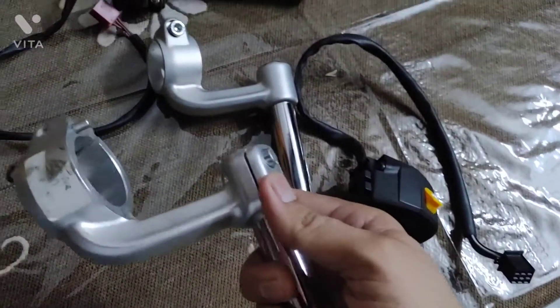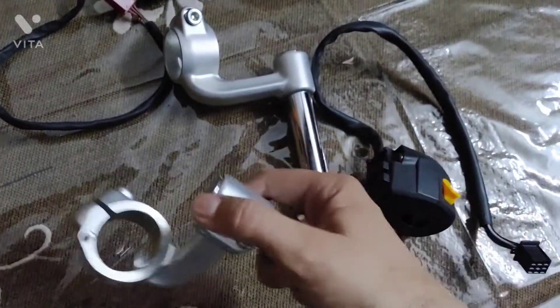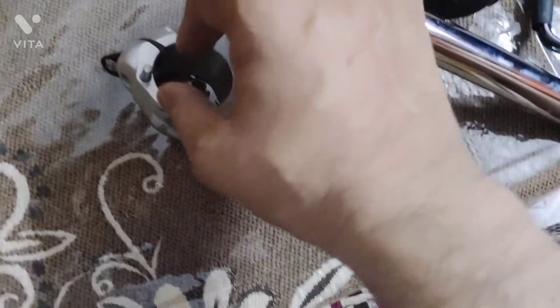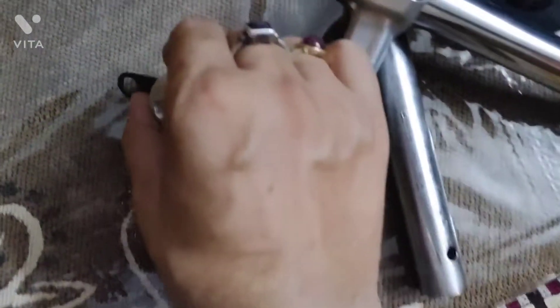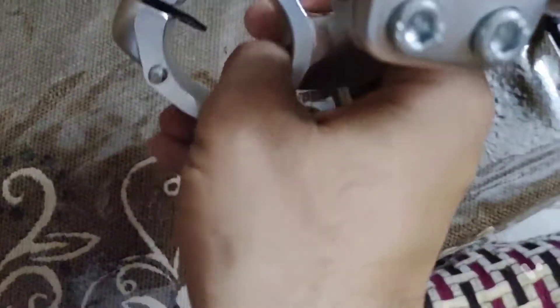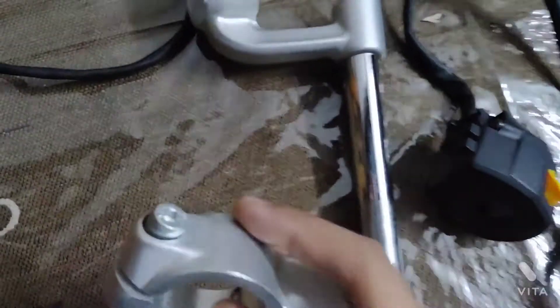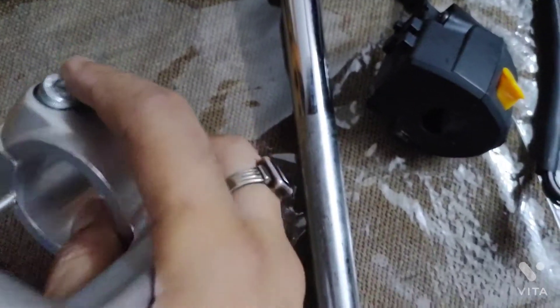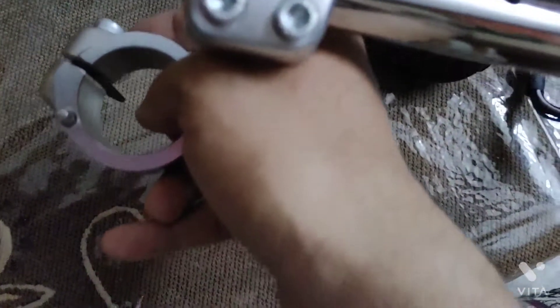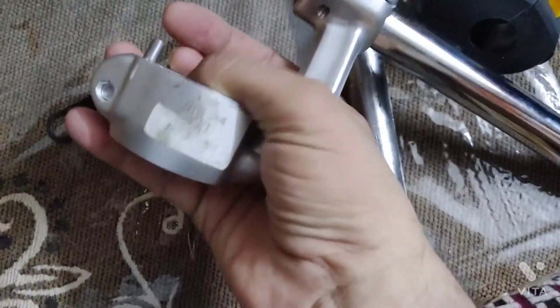In Hindi: these clip-ons are used in the 650cc and I am trying to use them on the 535cc. Some modifications have to be made — the bolt and the clip that fix underneath the triple tree keep the handlebar from moving left or right. Without them the handle may move, but this bolt is sufficient to prevent movement, though there is some risk. The company has a good system — this clip and this bolt are provided for that reason.